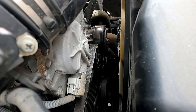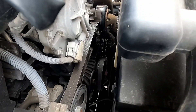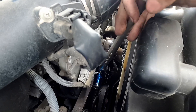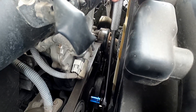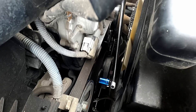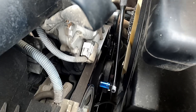I'll take it down, we'll pick up a new one and replace it while we've got the truck here. To get that off you need to take the belt off. The tensioner or the belt is right there — you can see me pointing at it. I've got a breaker bar with a 15 millimeter on it and you just stick it down on there and relieve the tension on the belt. Then you can take the belt off and remove that idler pulley. I need both hands to do this so I'm going to put the camera away.